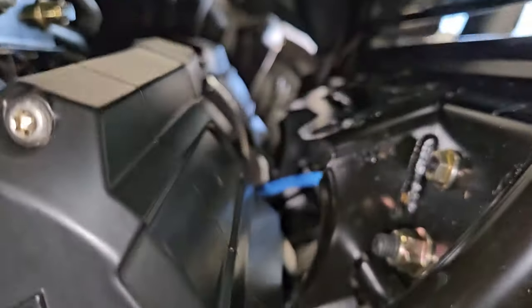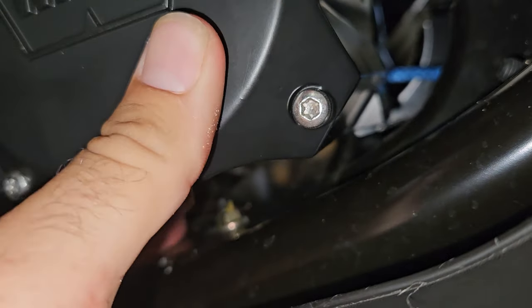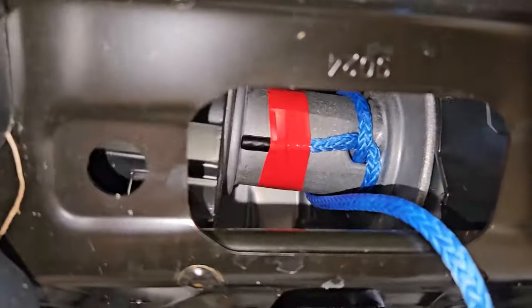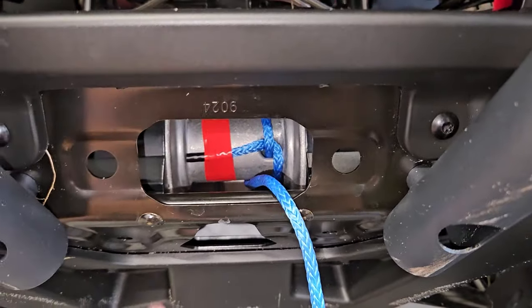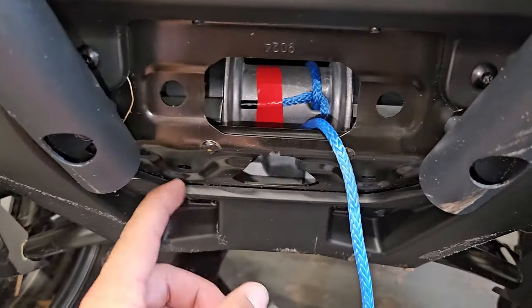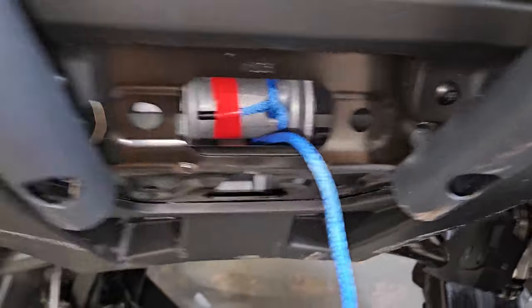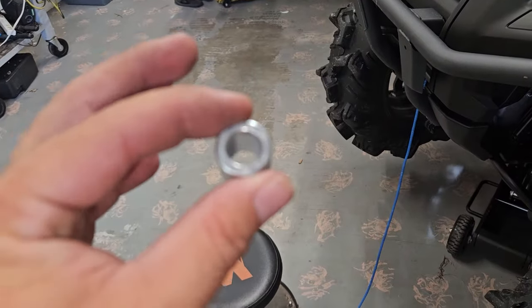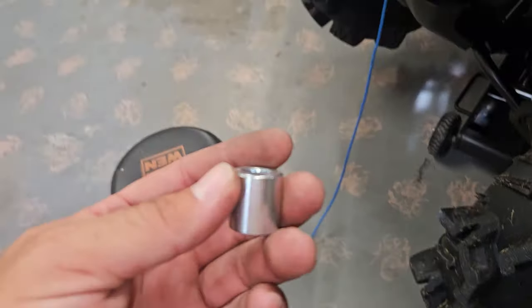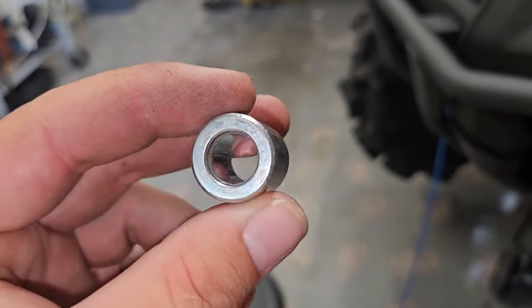So no surprise — this is not a direct fit by any means. The winch hits this bracket really bad before it can get down to the bolt holes, and it also hits the bolts that hold the front plastic on. This winch is a lot bigger than most ATV winches. I went with it because it has a very good free spool mechanism and I frequently have free spool issues. To make this work, I'm going to put longer bolts in these four locations with big spacers to get the winch up off the bumper for enough clearance. I found the perfect spacers in stock — they go between the winch and the bumper in all four spots, along with longer bolts I had laying around.